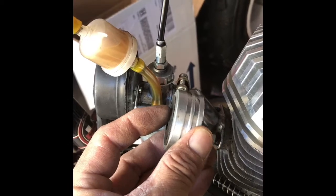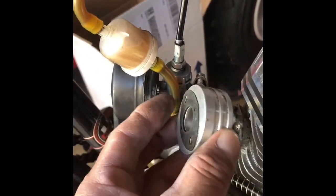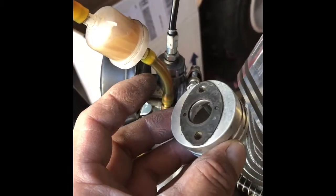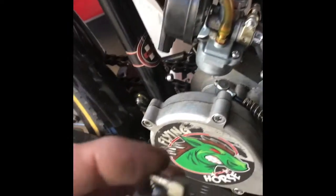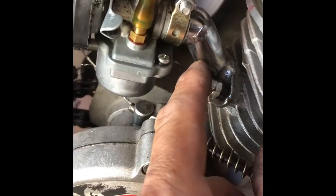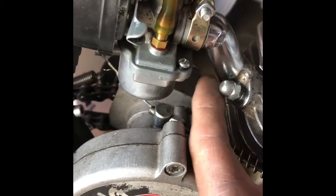JB welding it should give a good, well-attached area. It does have a pulse line but that's external. I'm going to drill a small vacuum line hole further down and that's where we'll get the pulse, then route it to the carburetor.